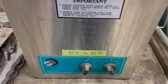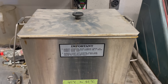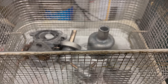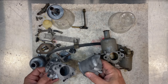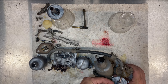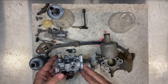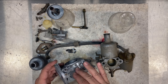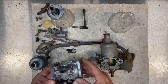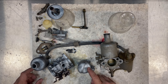Just turn it on, put the top on, and leave it for an hour or more. Now they're all done — all the grime has been cleaned off. You can see the parts are cleaned up a lot compared to what they were before; it's a drastic difference. Just make sure that when you take your carb body or any parts with small holes, you take an air gun and blow all of them out after removing from the ultrasonic cleaner.